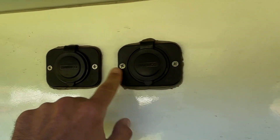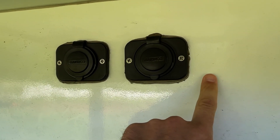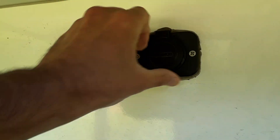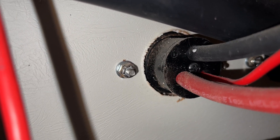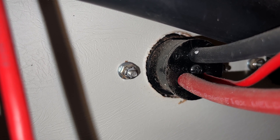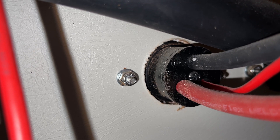In the last video I had used the screws provided with the kit that went right into the plastic, which did not work - the first time I pulled the plug out it ripped out. I ended up getting some countersunk machine screws with a washer and a nylock nut on the other side, and it hasn't moved since. I'm really happy with this charging system - it's been about 15,000 to 20,000 miles and provided nearly all of our power. The biggest issue was the breakers kept tripping, and now this solves it completely.